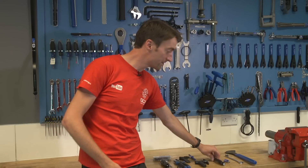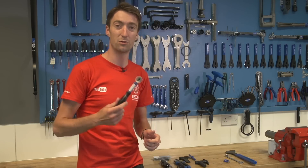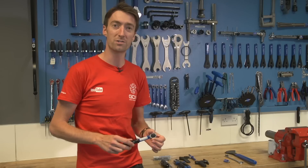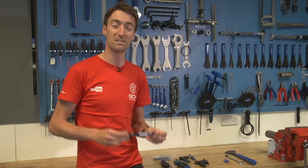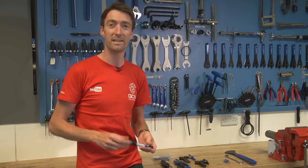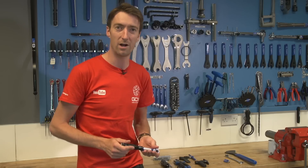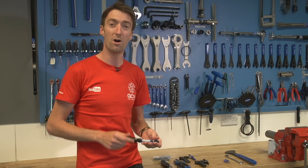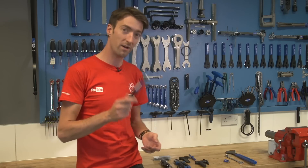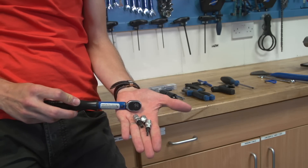The next tool on our list is something that's not that common even amongst experienced cyclists' toolboxes, and it's a torque wrench. You'll find that most bolts on bikes these days have got a range in which you have to tighten them in terms of newton metres, and this torque wrench will make sure that you get them tightened up within that range. That's important because it's very easy to over-tighten them — they can snap on the spot, or even worse they might give way whilst you're out riding. Having one of these might not only save your skin but it'll also mean that you don't invalidate the warranty of many of your parts. One like this, which is quite small, along with the allen key fittings, will suffice for most bolts on modern bikes.